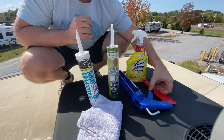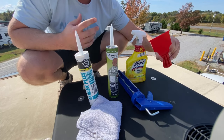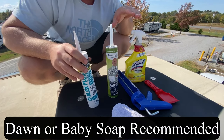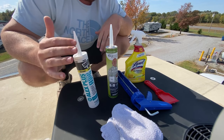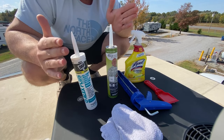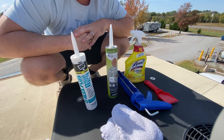A few simple tools you're gonna need for this project: you want to make sure you have a plastic paint scraper. You don't want to use a metal one because you can cut the TPO roof on an RV. Once you get the old lap seal off, you're gonna clean the area where you're gonna put the new lap seal down. Then what I like to do is create a barrier so the lap seal doesn't run everywhere — using basic caulk. Let that dry so it has a border, and then you're gonna put the new lap seal in between that border of caulk. So let's get started.